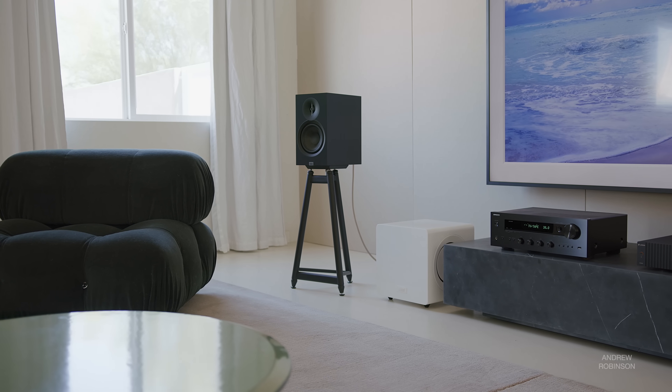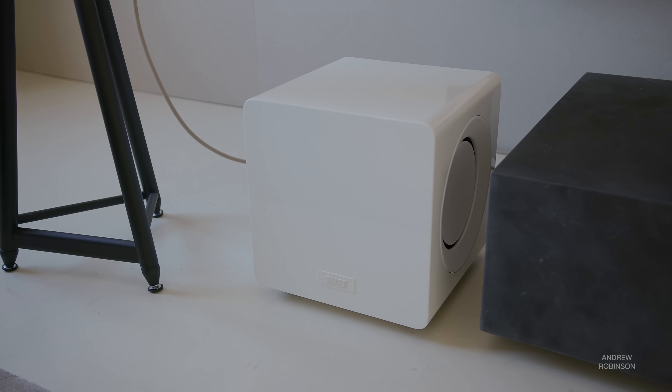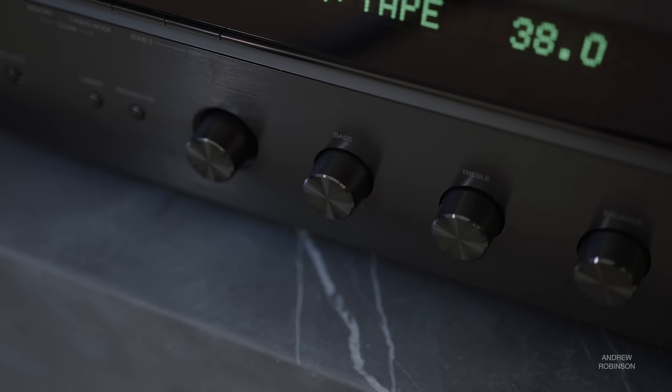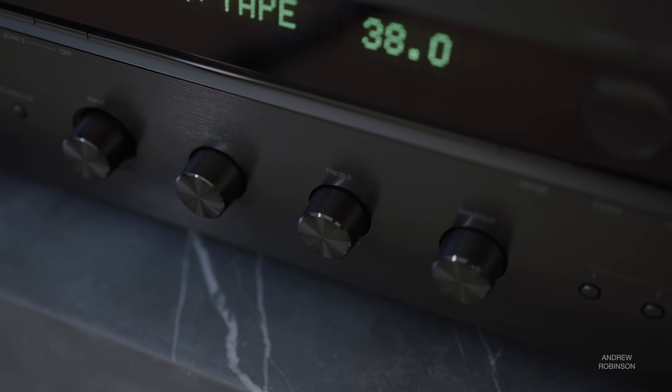For more compatible speakers, the Nanos and the new Elacs were far better suited for the Onkyo. Since neither are full-range speakers, I used KEF's KC92 subwoofer to ground their performance. The Onkyo does not have any bass management, so you'll need to set your subwoofer's level, crossover, and phase on the sub itself. I ended up setting the KEF sub to crossover between 60 and 80 hertz for both speakers. The lack of bass management and basic room correction may not be the end of the world for some, but for $800 from a brand well-known for exceptional AVRs, these two omissions are a head-scratcher. The Onkyo does give you tone controls and balance, which is nice, but again — pretty old-school.